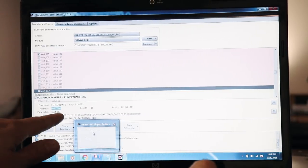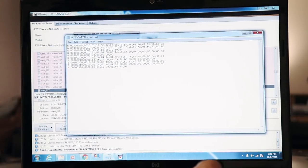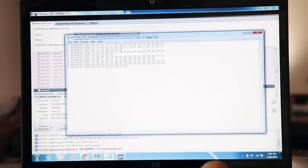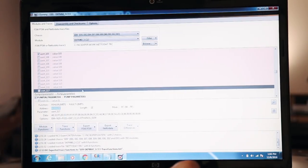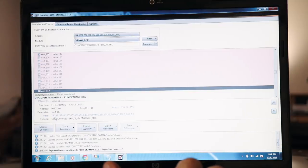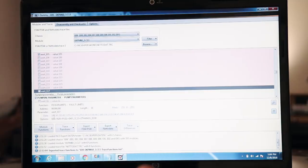A032FF2D. The first four bytes here are what we're worried about. So what I have now is A0. That's the same. That works out to 160. But I have 1D on the low side, B4, 14. If I want to, all I gotta do here is copy these values. Let me change this into decimal. We can't say with certainty that this correlates to exactly, let's say, 160 divided by 10, right? It's just between 0 and 256, that is, you're at 60 something percent. That will translate, if you were to calculate, into a voltage on the high side. This will translate into a voltage on the low side.